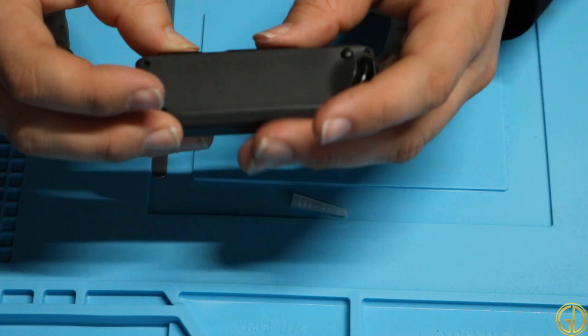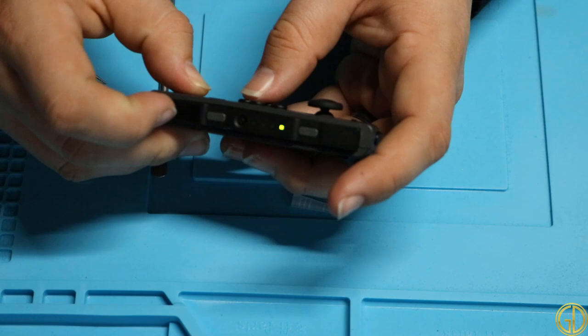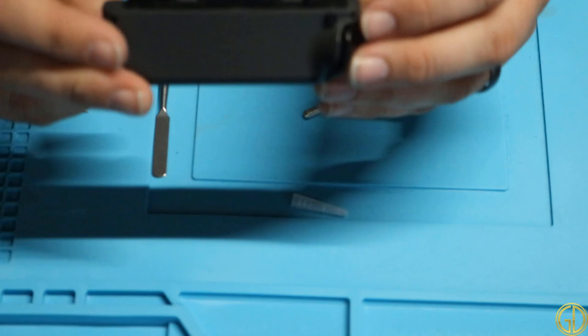But it is in there, and more importantly, whenever you push buttons — as you can see — it is now working again. It was not lighting up or anything because nothing on this bar was actually connected anymore. So my student will now have a nice working Joy-Con again. Awesome.